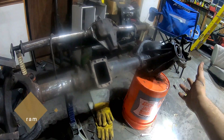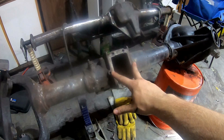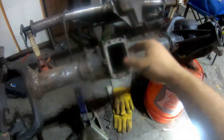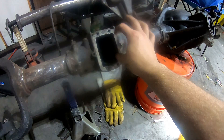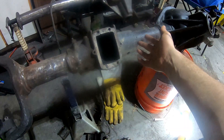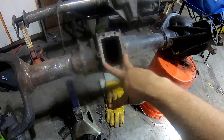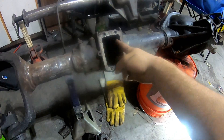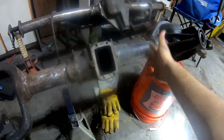This is a Dana 30 for the front end out of a YJ. The Dana 30s on the YJ had this piece here — it was a split axle shaft, meaning there were two axle shafts with a sleeve in the middle. When you put it in four wheel drive, it connects both axle shafts together. That's fine if you're not off-roading a lot. It was vacuum actuated — when you put it in four wheel drive through the transfer case, the engine sends a vacuum signal and slides that piece back and forth. I got rid of that and have a cable actuated one, but we're going to beef this thing up.